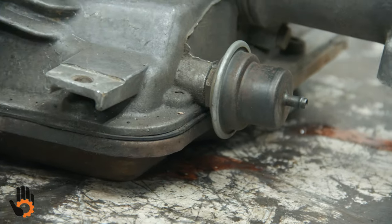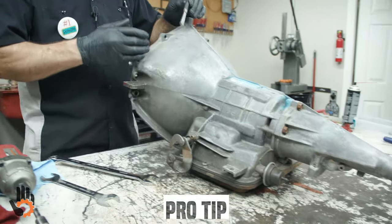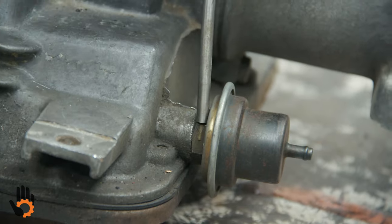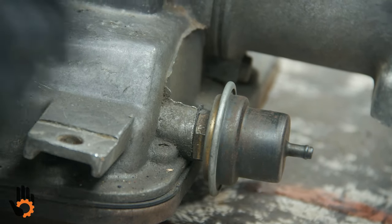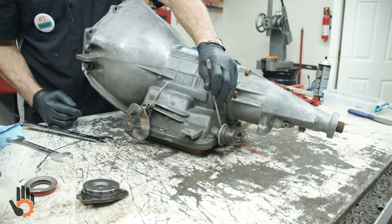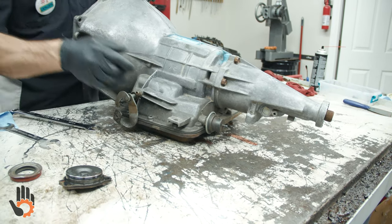Just as a side note, you don't have to buy the high dollar wrench. The way I used to do it, because I didn't own the wrench for many, many years, was you could take a flat punch of the right width, come in against one of the flats, and then you would simply knock it a few times, break it loose. Same thing when you went back together: thread it in by hand, come across here and just smack her a few times. Didn't have to get killer on that. It's just a gasket, just to make a tight seal.